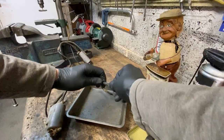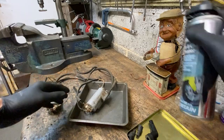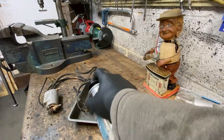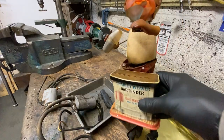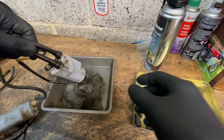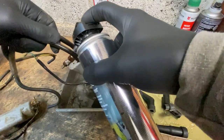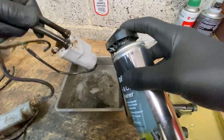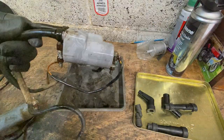I pull off the old plug caps because they're really loose. I'm going to trim back the leads and make them fit nicely, and then give them some brake cleaner to get rid of all the grease and grime. With the coils cleaned I'll make a little bracket out of some aluminium so I can bolt them to the cam cover on the engine to stop them rattling around if the engine starts, and then go outside into the garden and fit them to the engine.